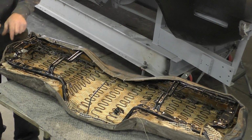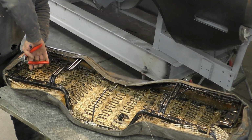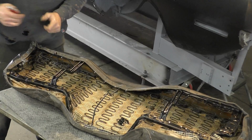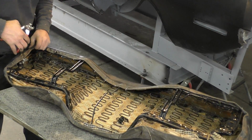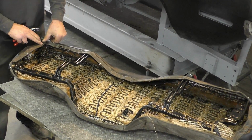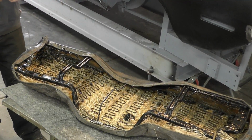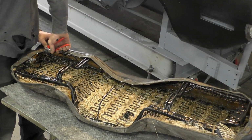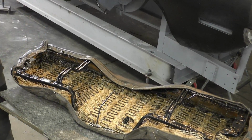We're actually gonna do this back corner first. We're gonna roll it up, and I don't wanna go crazy with it, because we also want some of this to push against tight with the new wheel tubs. So see, if I did that, and I work my way to here, and then you see that's going to fold over like this. And I'm happy with that. I think, you know, for what we're looking at on this car, that will look really good. We'll flip it over, making sure it doesn't look crazy, but let's get this corner and then we'll get on to the other side.